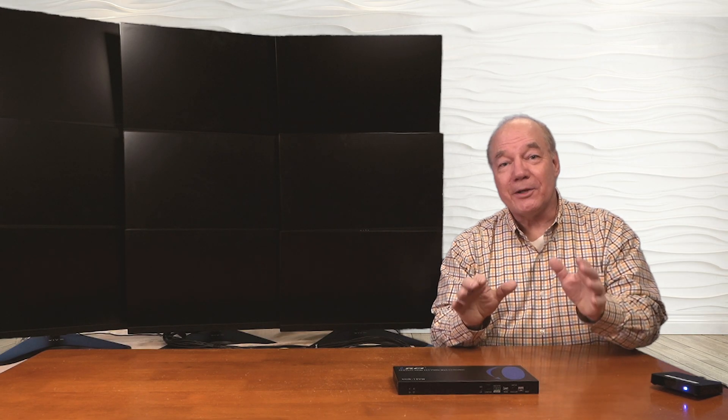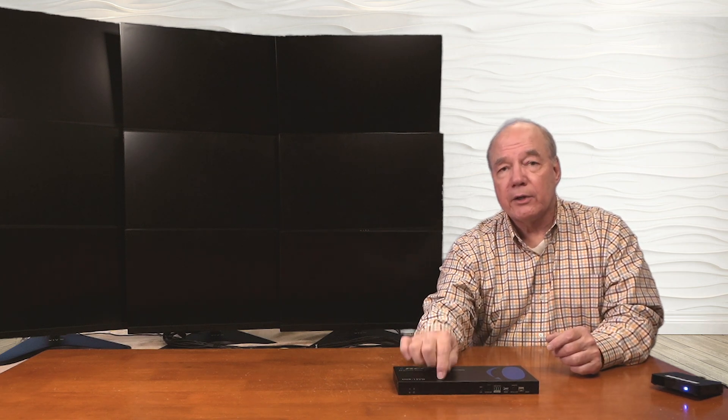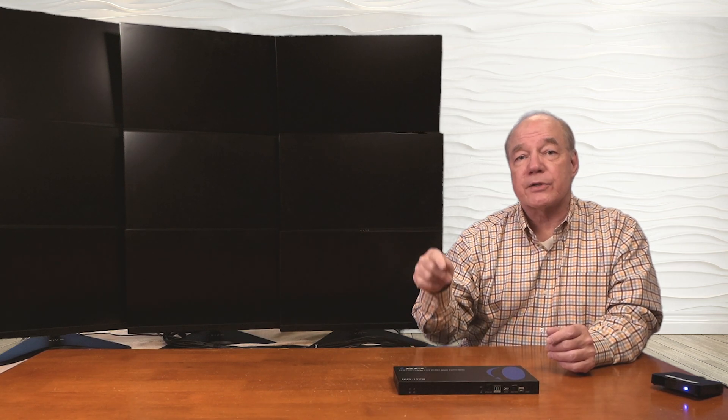Now I'll show you just how easy it is to use this product with your own equipment. For this demonstration I've set up a small media player currently looping a video — that's the media content I'd like to display on the video wall. Over here I've set up nine monitors in a 3x3 configuration. This unit supports nine different configurations; this is a 3x3, but you can also use a 2x2 and seven other configurations. Once you've set up your monitors you'll need to adjust the DIP switch settings on the front to match the configuration — those are fully explained in the manual. It's also important to use high-quality cables and label them so you know which HDMI port each monitor needs to plug into.